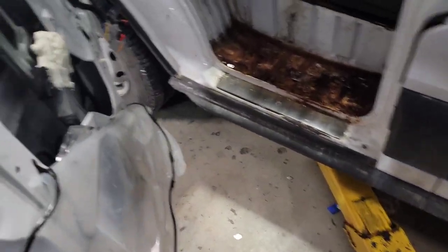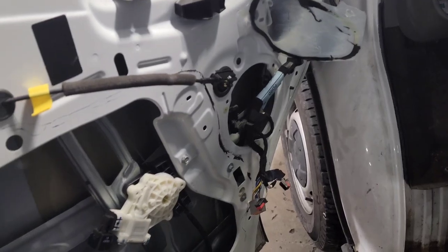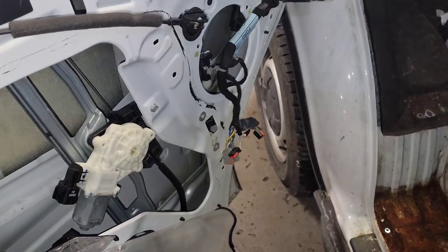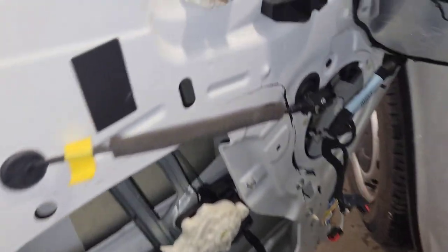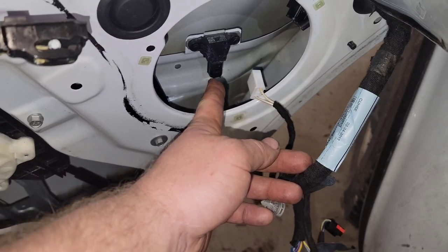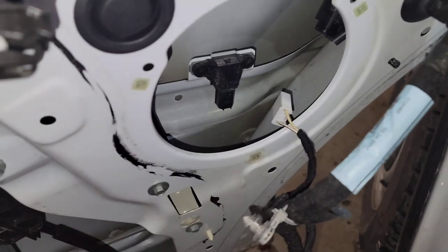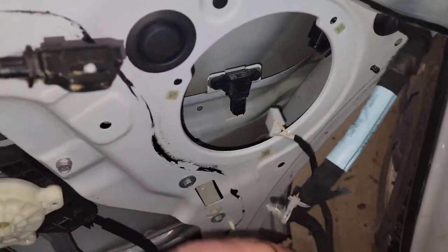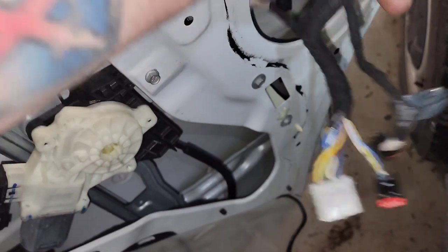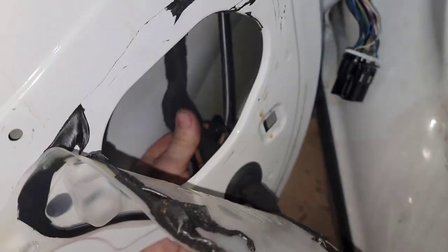Tracing down wires. I've got multiple problems going on but the main one I want to show you guys is a B1313-93 side obstacle impact sensor, driver side — B1313-93. What I do is I pull as much of this harness inside the door loose as I can without pulling it all out, just to make it so it can be moved around freely.